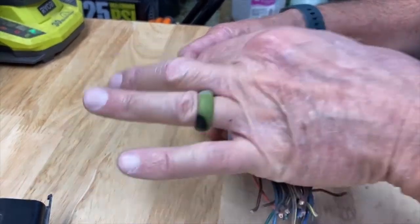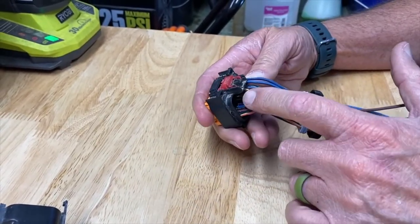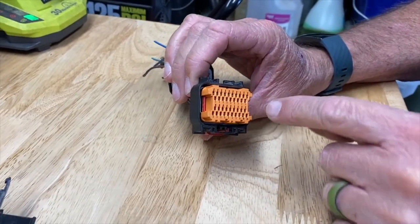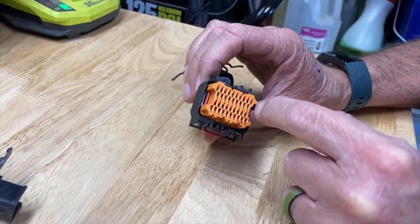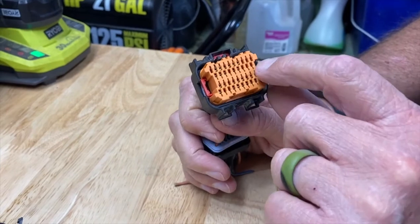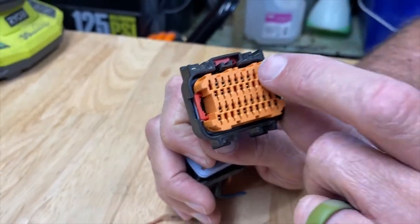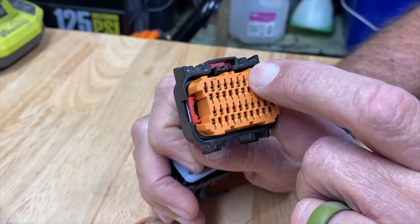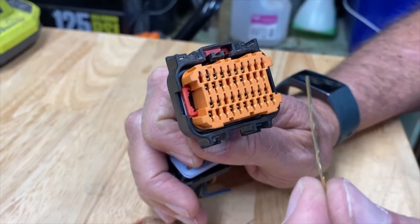What I've done is take this piece and slide it back on the wires. The blue gasket is down in there — you pick that out with a little screwdriver and slide it back so you can see the wires. Then there's a little locking mechanism right here. I put a screwdriver and popped that mechanism to the side — that unlocks the wires so you can remove them. When it comes time to remove them, they say you need a special tool. There's a tiny slot right above the hole, and the special tool fits in there. I tried a lot of different things until I tried a really slender paper clip.